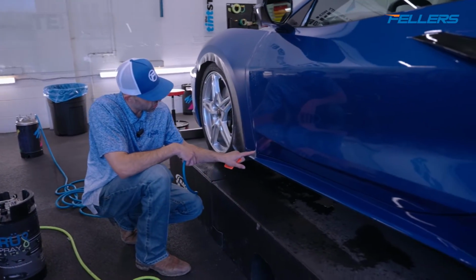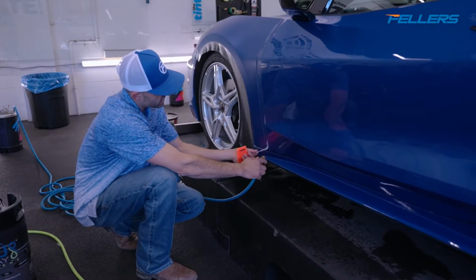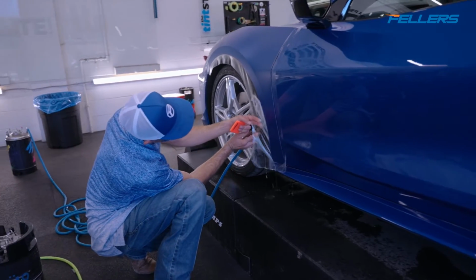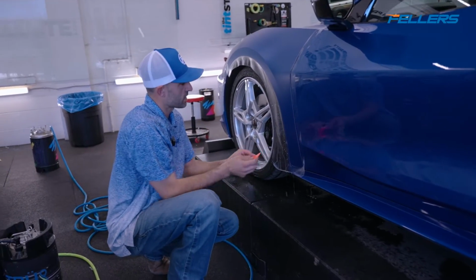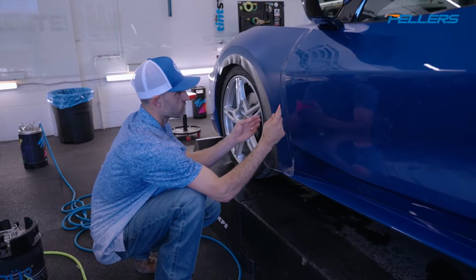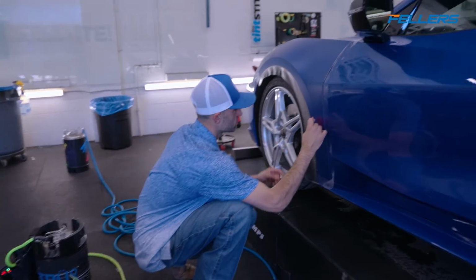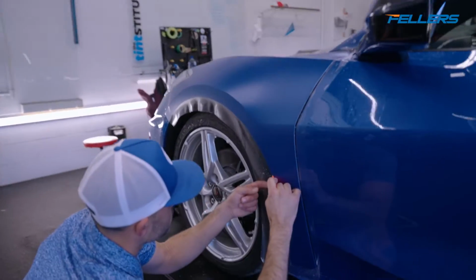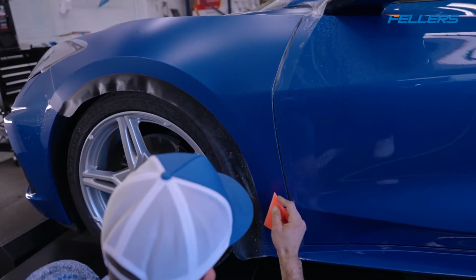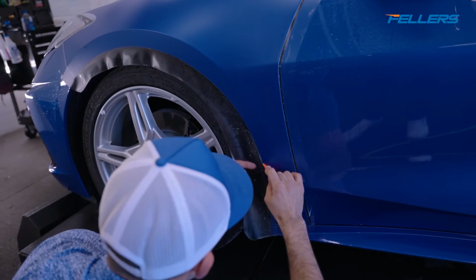So when I see soap around the edges, I'm going to take my tack solution, go around the edges, and get everything nice and tight against the edges before I make my cuts. So this is why I love these Trek squeegees from 44 Tools, is because of that point and the ergonomics. Come in here so you can see me use it. So I'm lifting that up, and because it has that point and I can wrap my finger around it, I can get so detailed.